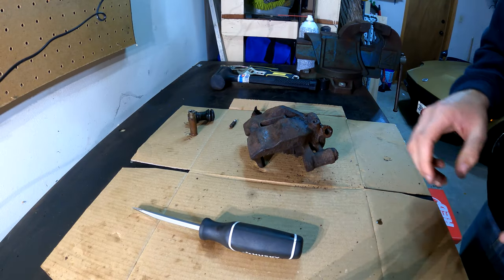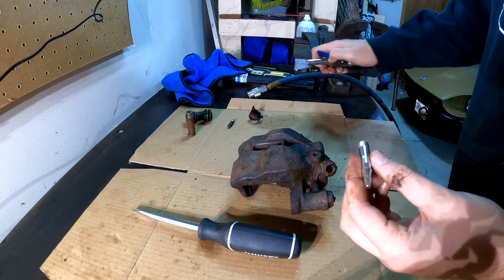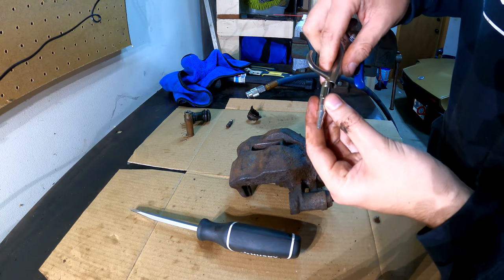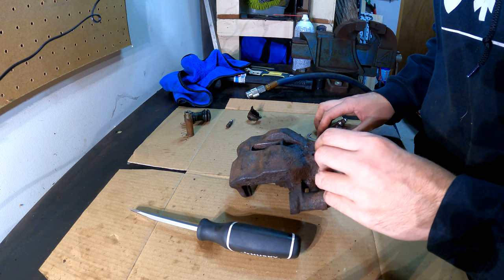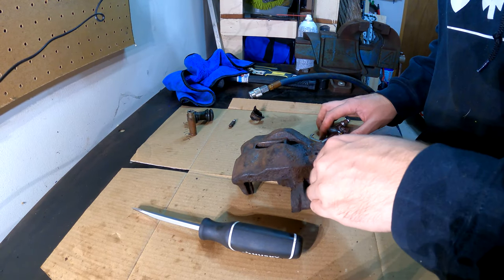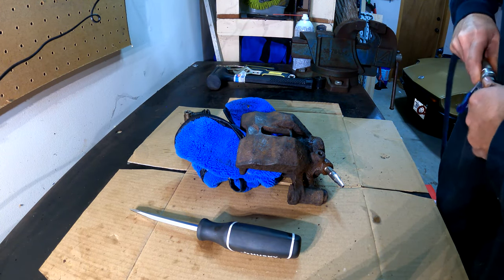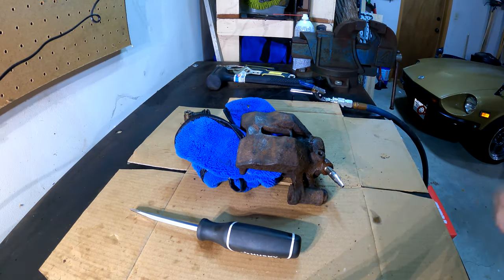Okay, let's put some compressed air to this thing. I would definitely take this with a grain of salt, but these are little attachments I have for my air hose and this thread actually threads into here. It works well enough that you can jam this in here, get a good enough seal, and actually pressurize this. We're not tightening this down too much so I don't think it'll actually damage the threads at all. You're definitely going to want to jam a rag or something in here because this literally sounds like a gun when it lets go. Also definitely wear safety glasses because you'll get crap shooting out from all sorts of different directions when you pressurize this thing.